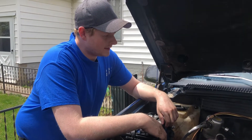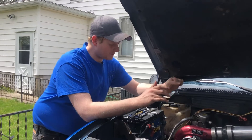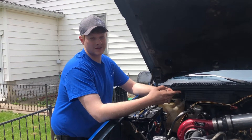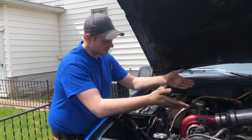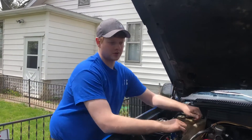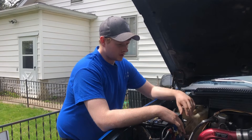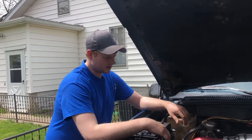Here are some things I learned doing head gaskets - this is something most people really don't take the time to look at. I used torque-to-yield bolts again because I'm cheap, and I'm not going to take the other side apart to put ARP studs in. I checked the deck and head with a straight edge, cleaned the holes, did the whole thing, put it all back together - no cooling pressure. It's great, but something I want to talk about is...